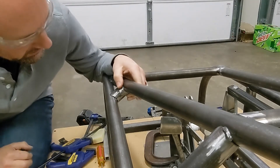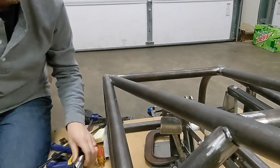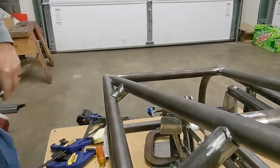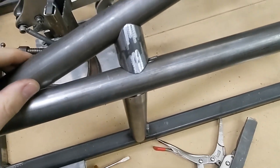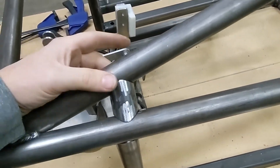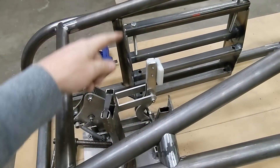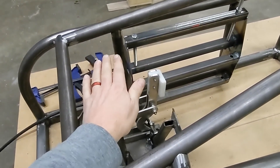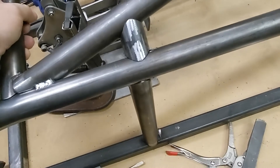That is really close — it's sitting up on that weld. I'll fix the fit and get it in there. Let me get the camera a better shot so you can see how far I'm off, which isn't much. I'll come back through and fine-tune the fit and slide it in until it lines up nice. Then I'll do the other side, and there will be another two tubes going all the way across here — that gives me two nice planes where I can make the mount for the front steering box that lives up here.